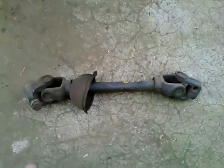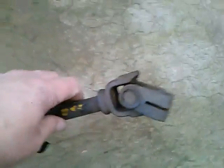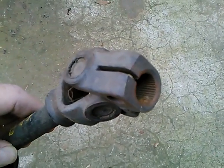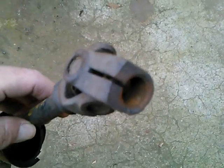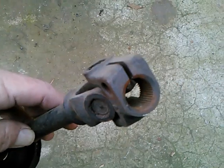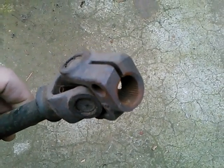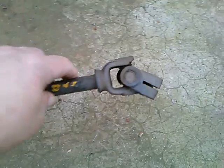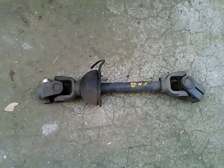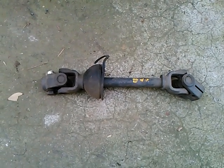What I've seen other guys do is take this shaft — this is from a Super Beetle — and it does not have the same spline as the steering box. But apparently, clamping down enough on this to squish it will create enough friction with the steering shaft on the steering box to make it turn. But I certainly don't recommend that. It would be clever, of course, to have the VW Super Beetle U-jointed shaft on your VW Baja Bug — I just never found a practical way to do that.